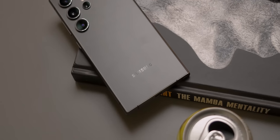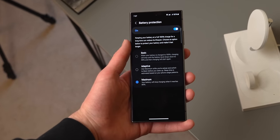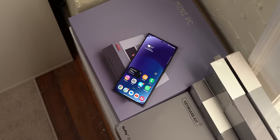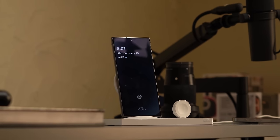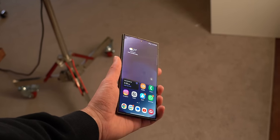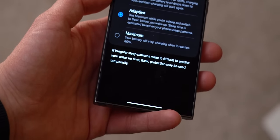There are three different modes depending on how long you plan to use your phone. Samsung has promised over seven years of software updates, so if you plan to use it for that entire period, I recommend using maximum mode which only lets your phone charge to 80%. If you drain your phone every day, adaptive is probably the best and is the one I have on — it uses maximum mode while you're asleep and then changes to basic just in time for you to wake up, charging to 100% and stopping until it drops back to 95%. Just note that if you fall asleep at varying times each night this may not work as well.